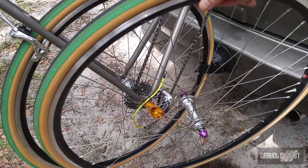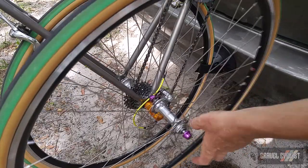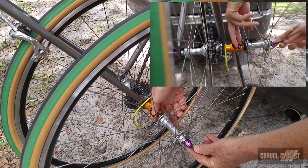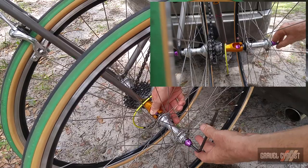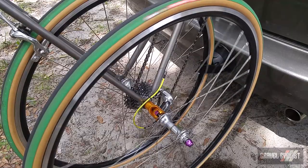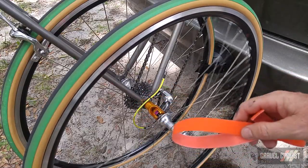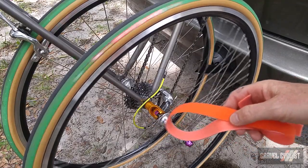And this particular front wheel utilizes a bolt-on type quick release, which is an older style. So I'll have to use my Allen key to tighten this one down actually. And there you go. That's it, that's done. So the front wheel is held in place, and to stop the wheel rotating during transport, I would use the supplied Velcro strap. It's orange, it's easy to find. Lash the wheel to the frame, and that will solve the wheel spinning around whilst you're driving along problem.